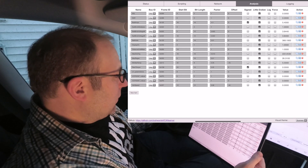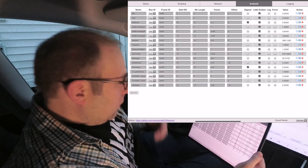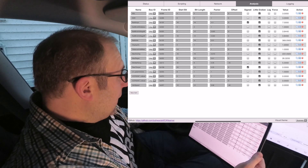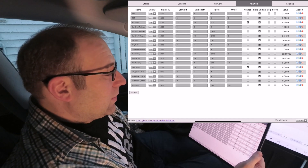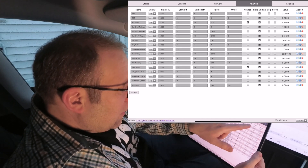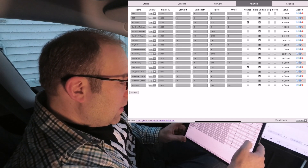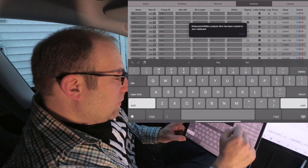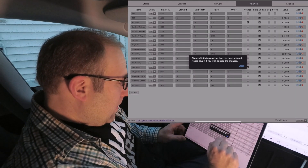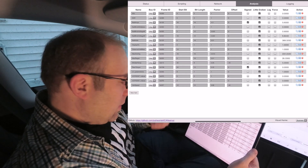The analysis tab hasn't changed too much. You can see all your signals that it's currently decoding, to be used with the scripts. If you're just using logging capabilities or transmitting to another app, you don't need to worry about scripting and analysis. Tesla does change these things with every firmware update, so sometimes we get caught by surprise. But the really nice thing is we see values actively updating, and you can actually just hit one of these signals and it will copy it to the clipboard as a text file. You can at any time paste it back onto this web page — it's a great easy way to add gauges and work on them offline.